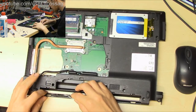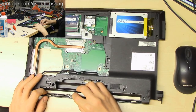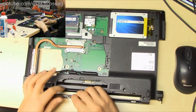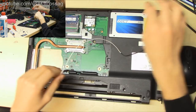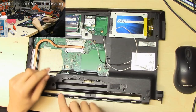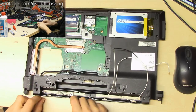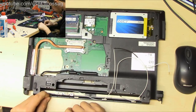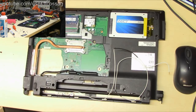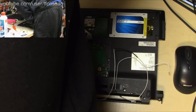Now, I know from experience that hot glue doesn't work well on these laptop plastics, so we are going to have to make some kind of actual mechanical mount. Zip ties aren't going to work, because we still need to mount the top case, and it would look absolutely horrifying if there was a zip tie going around there. So, or would it? Now let's just see if we can use a hand drill to drill a tiny M2.5 hole there and just mount in a small screw.